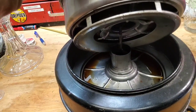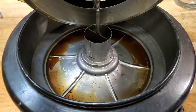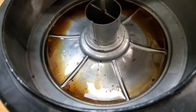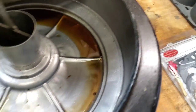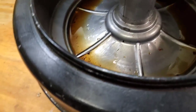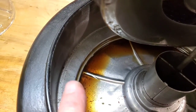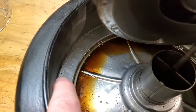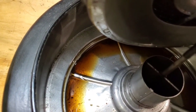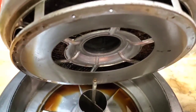So what we have here is this oil bath unit and it's kind of dirty — that's not very good. So I'm going to clean this completely out with brake clean or something like that. It's supposed to be filled with oil all the way up to this edge right here, but this is very low on oil, which is not good. We'll take care of that.